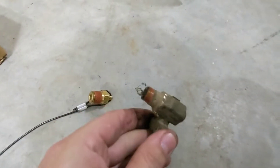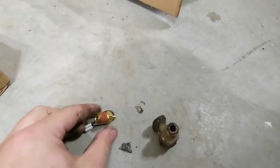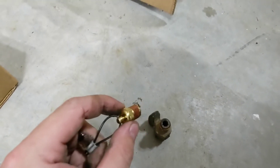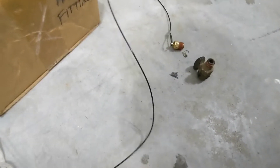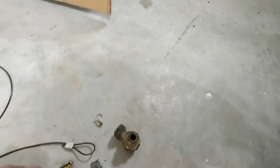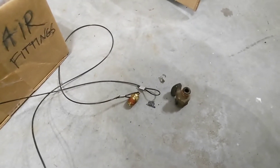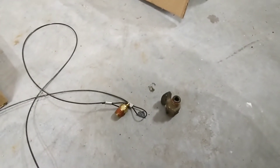Okay, we got the first one off. You can see it's just a simple little plug that turns up in there, and this little thing here is the valve that turns on and off. I have this dial now — these are already pre-threaded, so I don't need to use any Teflon tape on these, I just got to screw them up in there. But when you pull on this cord, which has a loop at the other end, it opens up the valve at the bottom and allows air and other fluids to escape. Since this is a tri-chamber tank, most buses are going to have three anyway, so we're going to install these on all of them.